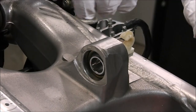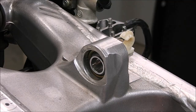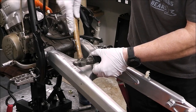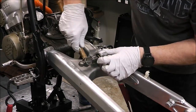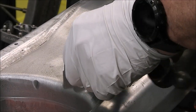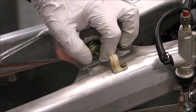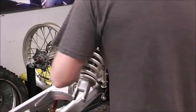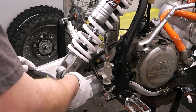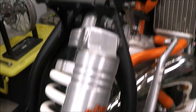Everything is open right now, which makes it easy. I'm measuring with calipers to make sure the bushing is centered evenly in the space, then I pound the seals in using a socket and put it all back together. When you're pounding in bearings, always find a socket that touches the outside edge of the bearing — never the center or the middle, always on the outside.